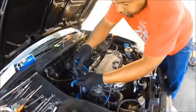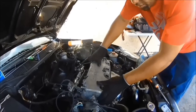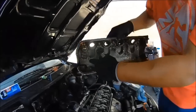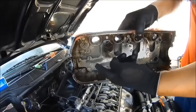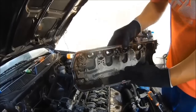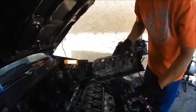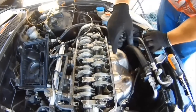Get your pliers, pull this off, take that off, break it free a little, pull it right out. Next, shake the valve cover loose — I already broke it loose; just crack it loose and pull that off. See this in here? That's a clear indication of a blown head gasket — when you got slush like that, that's water and oil mixed inside the engine. That's definitely a blown head gasket, or it could be a cracked cylinder head or cracked engine block. Also on the rocker arm, we have moisture and water everywhere — water shouldn't be there. That's a problem.